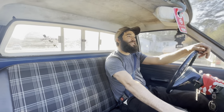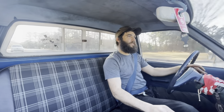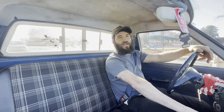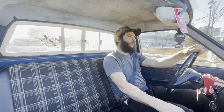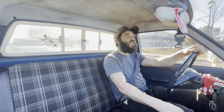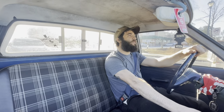So this is the test drive to see if the rear suspension is still going to be good for hauling stuff. Feels great. I think next time we're going to get the front suspension settled out, get her a lot closer to the ground, and hopefully improve the roll center. Man, this thing's sweet. I've had a 22R truck with a 32-36 and a 20R truck with a 38-38 — this is a 22R truck with a 38-38, and it's just peppy enough that it's hilariously fun. It's still super slow, but it just drives so good.